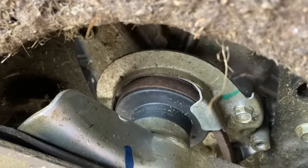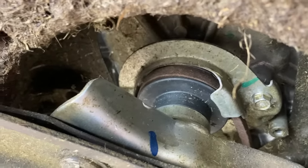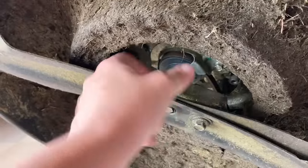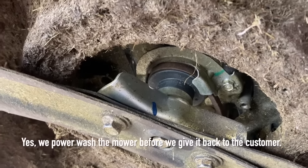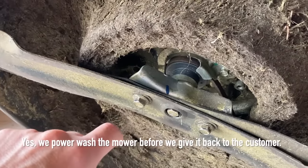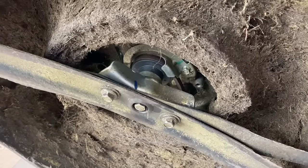This one had to have a new belt because it burnt the belt up. We've had ones with sticks lodged right here - for some reason everything is getting stuck in these mowers and it really needs some kind of shroud on the whole bottom to protect that, and it just doesn't have the room for it and is not made for that. You can have a brand new mower, use it a couple of times, clog it up with grass just from mowing moist grass, and the repair is going to be at least an hour - which is $80 to fix your mower when all it is is a bunch of grass clogged up.